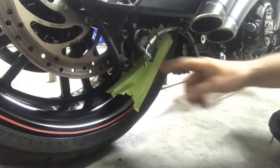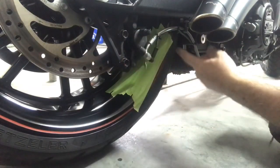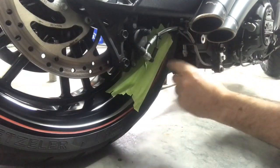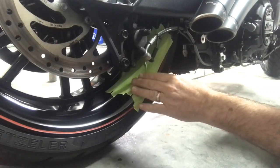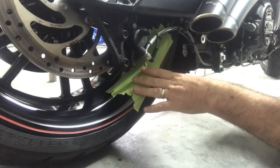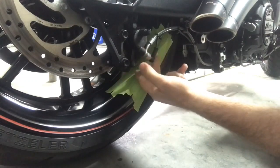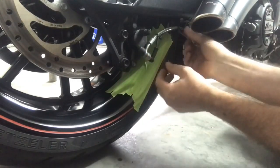We're going to go ahead and remove the brake caliper bolts — those are 15 millimeter — and the brake line bolt back here which is a 10 millimeter. When you take this caliper off, there's very little clearance between your wheel and the disc. Even if you're doing it on the front wheel, it's the same thing: put masking tape right here so you're not going to scratch your wheel, because you may have to finagle it a little bit.